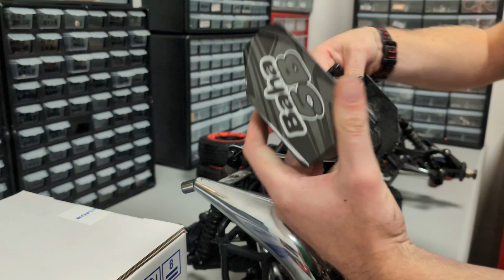So that's the whole top of the car off, and I'll just set it aside. Just to make my life a little easier, I'm going to take the exhaust off. When you're changing the engine, it's a good time to also upgrade the exhaust if that's something you want to do. So to get to these 2 bolts on the exhaust, you usually need a pretty long bit, and so I just come in through the back of the car like this, and then loosen it.